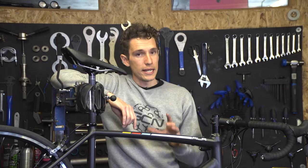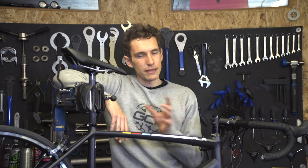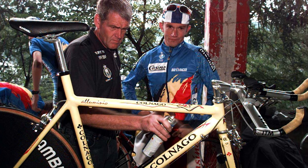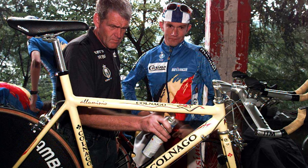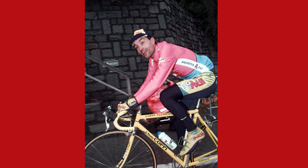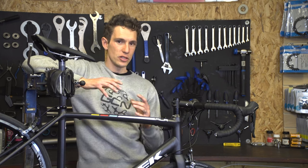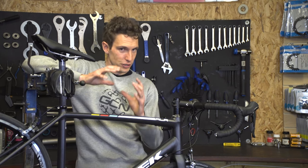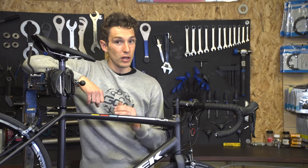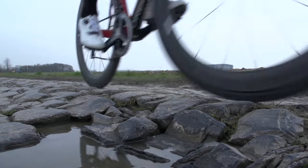The idea that aluminium is uncomfortable is a definite myth nowadays, at least. Its origins are rooted in fact, mainly thanks to the second generation of aluminium frames, characterised by those drop-dead gorgeous bikes of the early 90s, with their massively oversized and very stiff tubes. The main problem from that second generation came from the tubes, which were just that — tubes — meaning their properties were constant in any direction. Unlike a carbon frame, which can be made stiffer laterally but yet more compliant vertically.